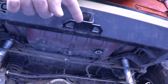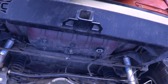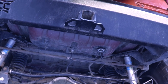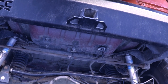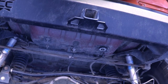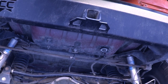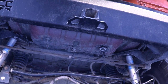Right here, bolted to the bedpan of my Jeep, is another Cyclone that provides some nice lighting under the rear of the Jeep. This one is tied into the door circuit — so if the interior lights are on from unlocking, opening a door, or opening the tailgate, this light comes on. It's a courtesy light but also provides a bit of rear illumination. It doesn't help me so much off-roading, but if somebody is spotting me they have some good illumination of what's behind me, and it's especially nice when you open your tailgate at night.